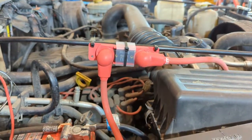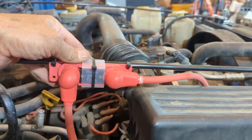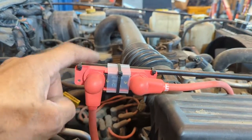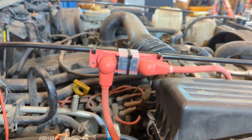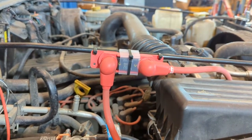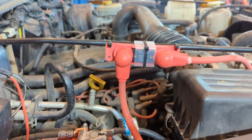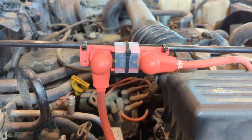One more comment I want to make on that is when you go to tighten these terminals, I would keep them loose until you figure out where you want to hang it and you got the fittings right. But when you go to tighten it up, be careful because the studs are embedded in plastic, is my guess, some sort of plate molded in the plastic, and you don't want to break that entire backing block there. So, like any other connection, such as to your starter or alternator, you don't want to crank those down and break pieces off of that.